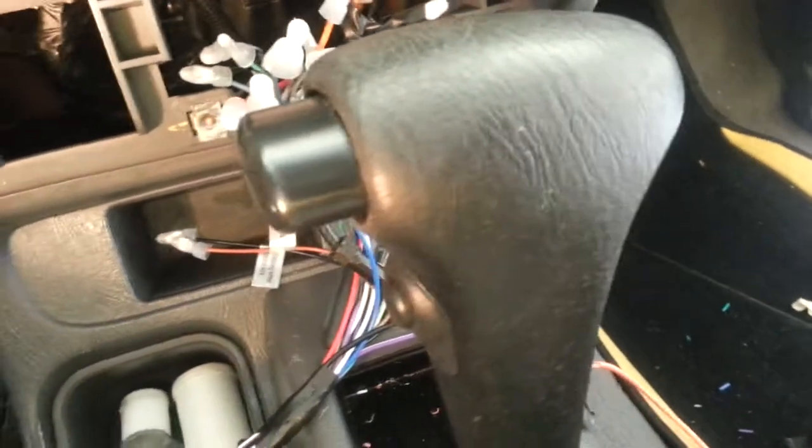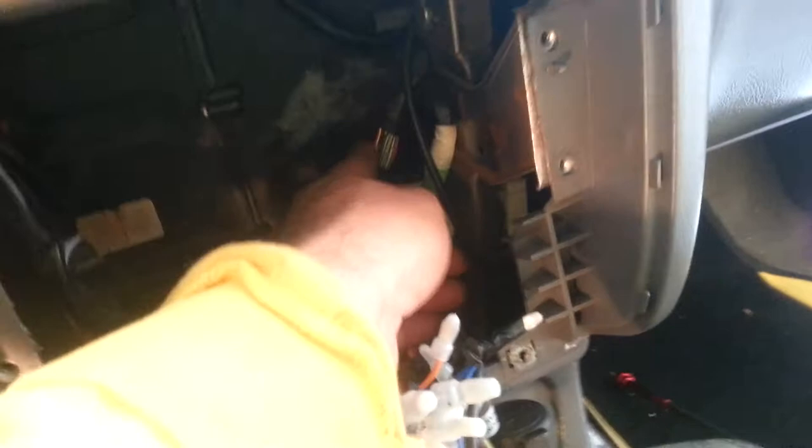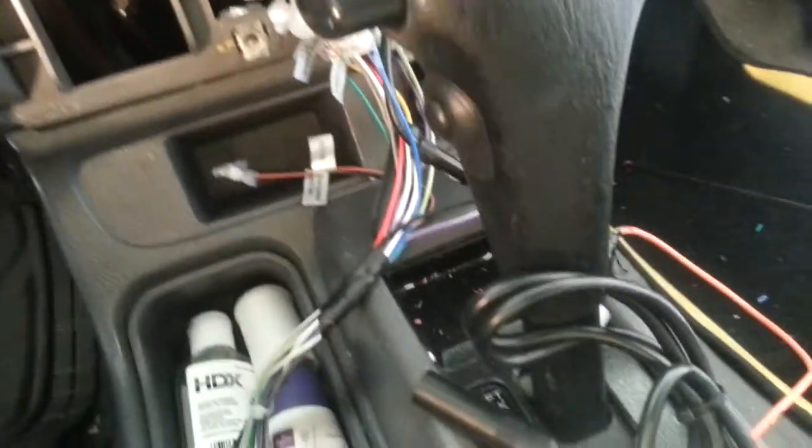You put all this wire down, so you have about 1.5 inches from here to here. Do not touch. If you leave the wire the way it is right here, it's touching the wire, the heat. I don't know if it would catch fire, but the best thing is to prevent it, guys. Very important. You want to be happy with your radio, you don't want to catch fire here. Because this part here was touching the wire right here, and now you're going to put it all the way down. Holding it here, you want to keep it down from here to here all the time so it never comes out. This is never going to have a problem, all right, guys?